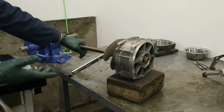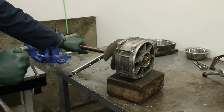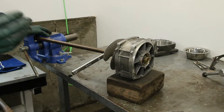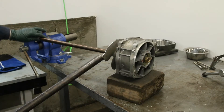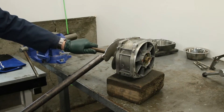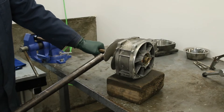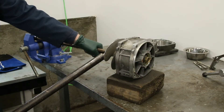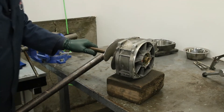It's quite early the next morning and I'm back at it, thinking about how to get this off. It just didn't feel right continuing — you could feel something was going to break, possibly even the vice. We were applying an amazing amount of torque, so we called it off. I woke up at five this morning and realized the problem: I can actually feel the shaft starting to twist right in here — this area is not solid. You can't get a good snap with the wrench; it's just bouncing. I've got to figure out a way to grab the shaft closer to the impeller.